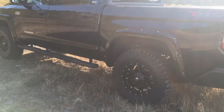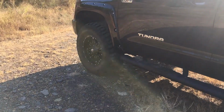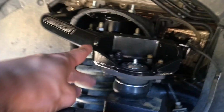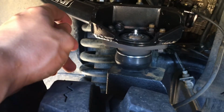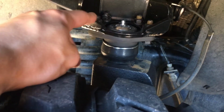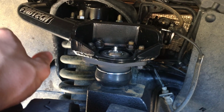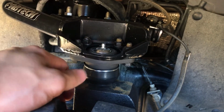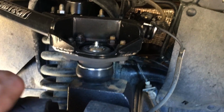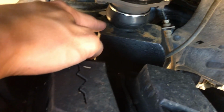I was between a 3.5-inch Zone lift and a 4-inch Fabtech lift, and the thing that sold me on the Fabtech, away from the Zone, was the new control arm. You can replace this bearing instead of having to replace the entire control arm when it goes out. And this is not a uniball, which is more of a racing-driven one. And this one I think is called, wow, I cannot think of it. I'll put it in the description. And then it also comes with the knuckle, which is nice.